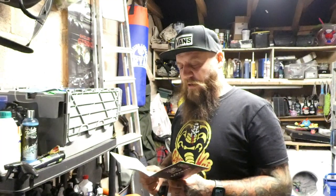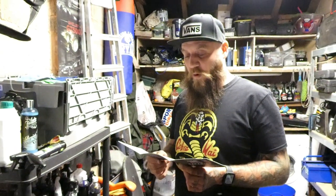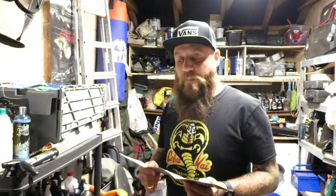So we'll prep first, and then spray a liberal mist of the wheel sealant spray over the wheel and work in with a supplied microfiber applicator. Then use a fresh microfiber towel and a light source to carry out a final buff. Ensure all residue is removed. That is it. Cool. So we have to just do this on the bloody floor.